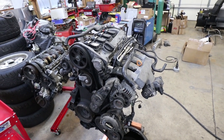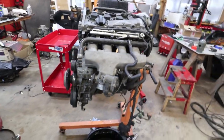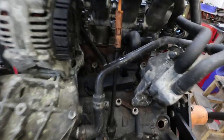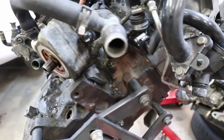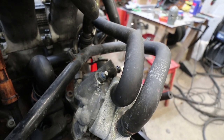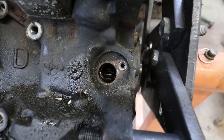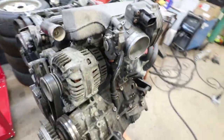The first step is removing all the wiring harness — all the clips, plugs, and sensors are all coming off. Now that I removed the wiring harness, I found a few things I'd missed. I had pointed out one knock sensor, but there was a second knock sensor on that little metal boss on the block there behind the oil filter console. On the oil filter console itself there's a pressure sending unit and a temperature sending unit — so there were two wires going there I didn't mention before. You can see where the crank position sensor reads the teeth on the gear. Everything else was relatively straightforward removing the wiring harness.